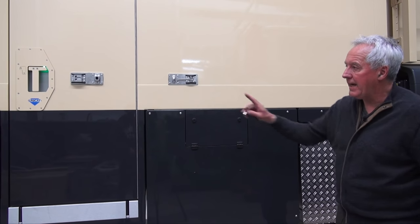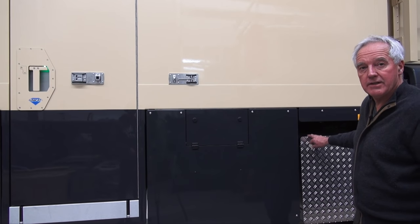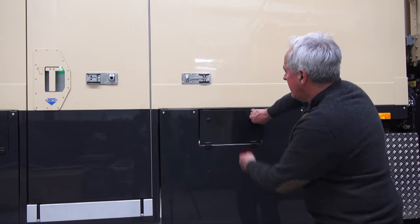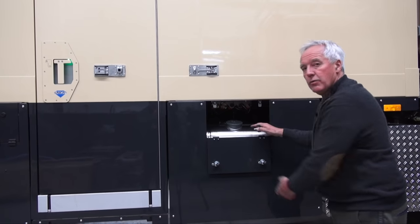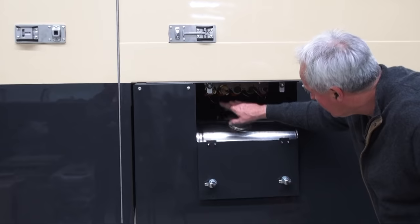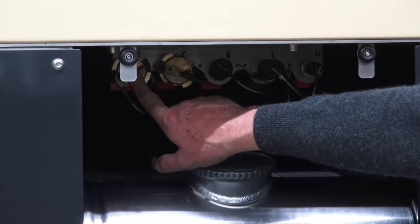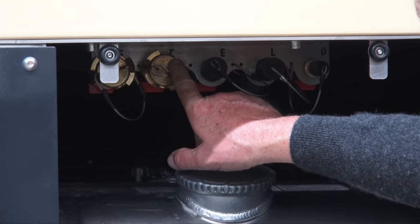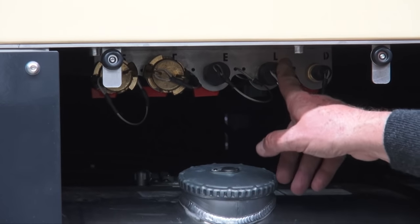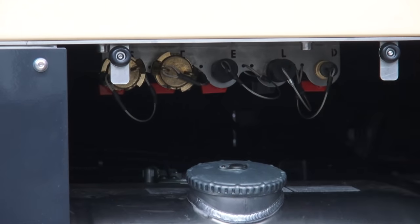Here in front of the entrance area, we have the exhaust system, which we have relocated to that place. And here we have the main fuel tank, which holds 280 liters. And we have access to the outside shower, another outside shower, to city water, to the winterization system. Here we have air supply, and here we have pressure filling of the water tanks.